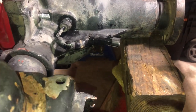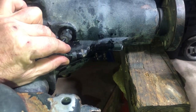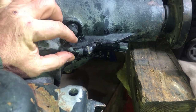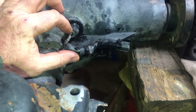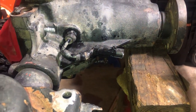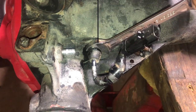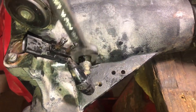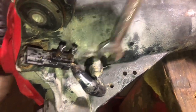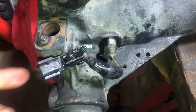That particular switch — if you were to have to repurchase this plunger switch, I found it online for like $130 for the Mopar one. But I've never had a problem with this plunger switch, so I'm very carefully going to unthread this. It should come out nice and go back in without a problem. Using a three-quarter wrench, but 19 mil would have worked perfectly. Didn't take much — just got to straighten that out and continue to unthread it. Pretty cut and dry.